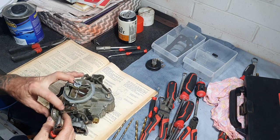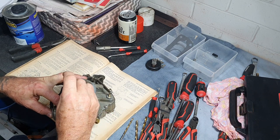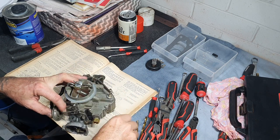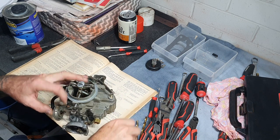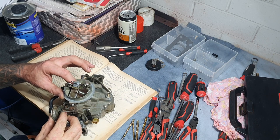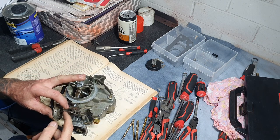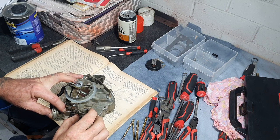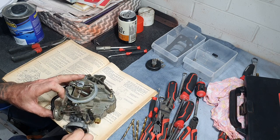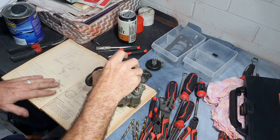Pull all the way back, take up the slack, then measure that gap — it's smaller than five mil and a bit bigger than four point five mil, so that's correct. There's the correct gap. When this diaphragm is fully depressed — there we go, that one's done too. That's the vacuum kick they call that.